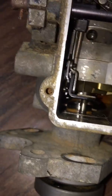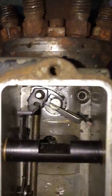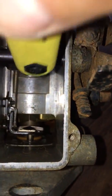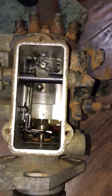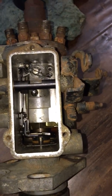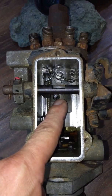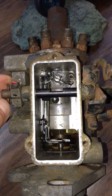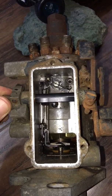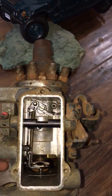So when you get to that position, you need to find the right size Allen wrench to stick through there and do it. It looks like this one is the right one, as a matter of fact. Anyways, you will figure that part out. It's super simple. In my case, because I'm using a turbo 6.5, this injection pump Allen screw has to be turned all the way to the max, and maybe just bring it back a quarter. At least that's what many reputable guys recommend, the ones who know how to work on this more than I do.